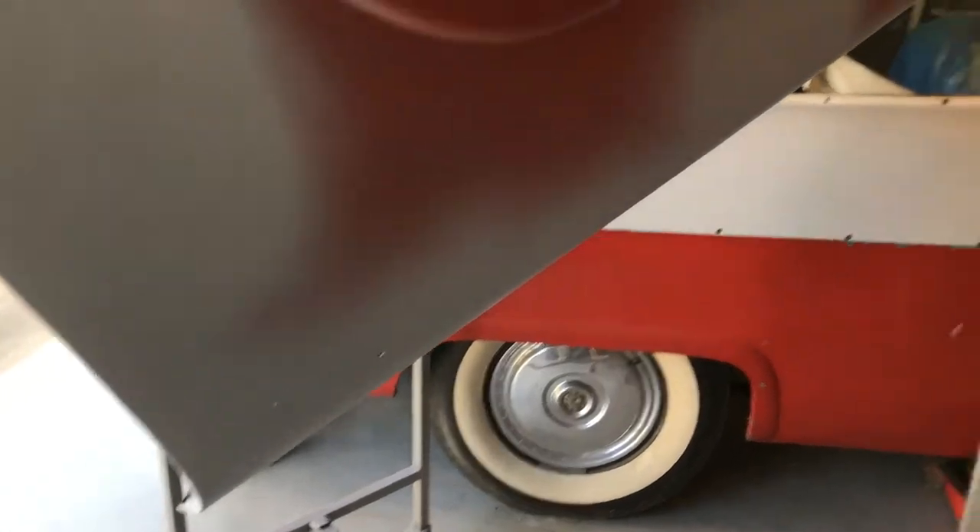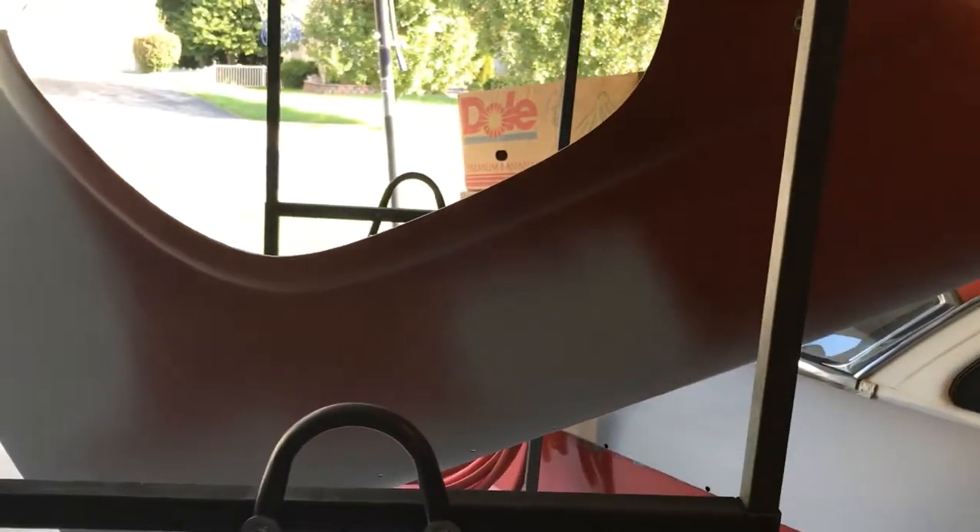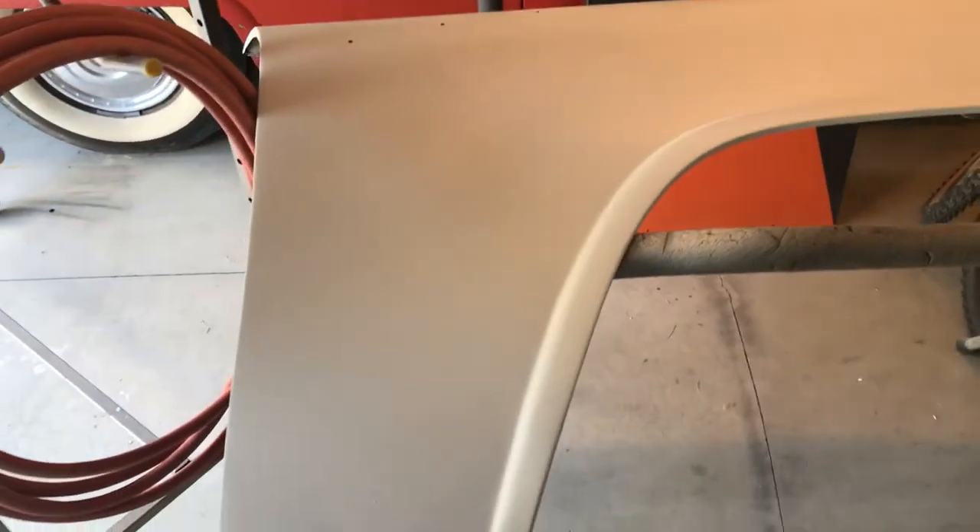And then on the other side, I just painted primer surfacer that fills it up, to try to meet the level of the red paint. I did take off all the white paint — it had rust underneath that. Blasted it a little bit and then just spot primed it. And then I'll sand it down and prime everything, just like this one here.